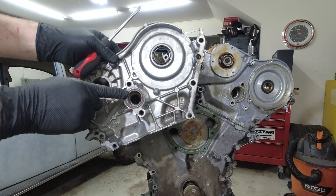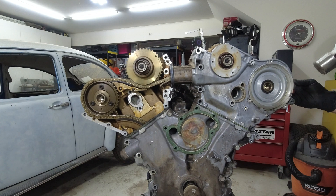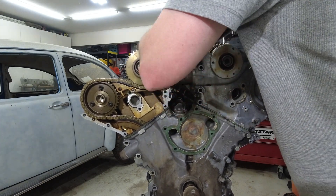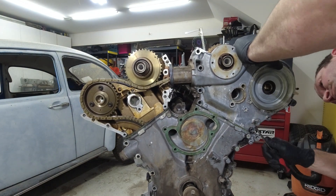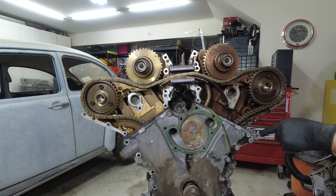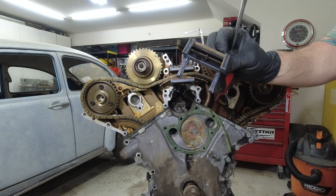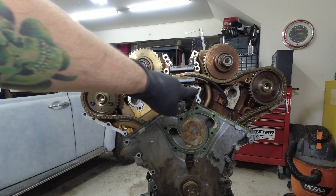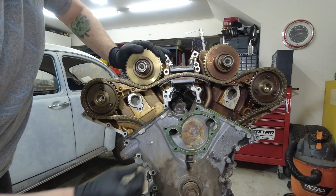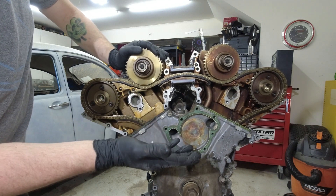Don't forget to replace that O-ring when it goes back together — that seals the coolant port that goes to the cylinder head. Make sure you place that gasket; it looks like somebody's been in here before, there's some gray silicone right here and some right here. Make sure you place these seals also. Something doesn't look right because that should be way over here and it should have another piece over here, but other than that they don't look too bad — better than the 119 did.